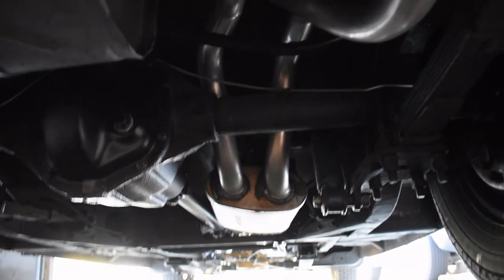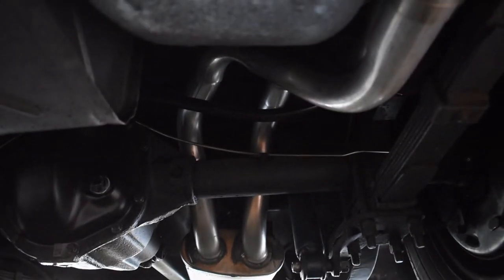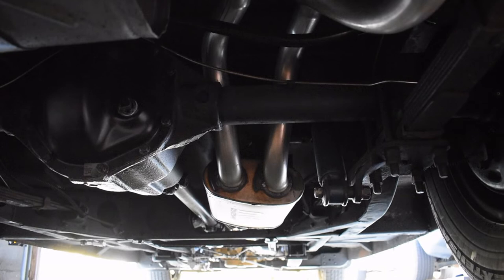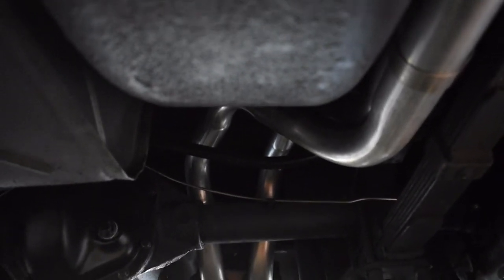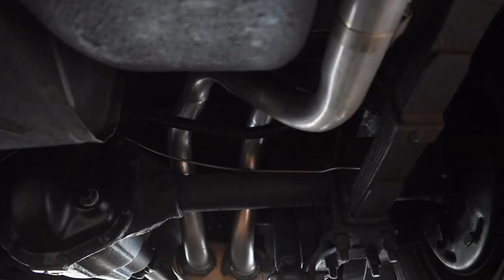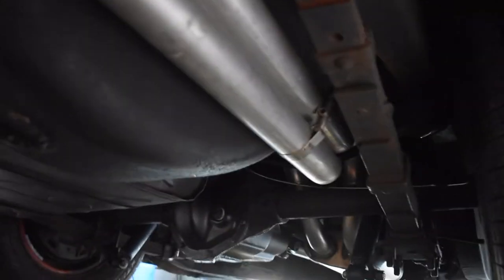Now we're at the tail end of the car, post muffler — this is where things get really interesting. This is the tricky part as far as pipe bending goes. You can see how the muffler is at an angle to avoid hitting the diff, and then both pipes spread out, go all the way up and over the axle, up and over the panhard rod, and then jump right back down immediately to dodge the spare tire well. As they do that they sort of roll over and lay on top of each other again. There are all kinds of ties and hangers along this stretch to keep them in place.